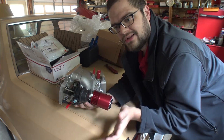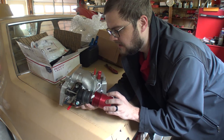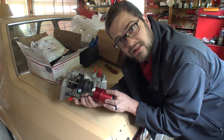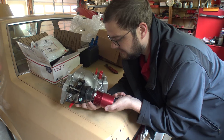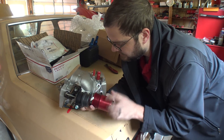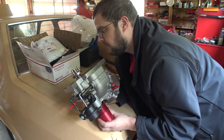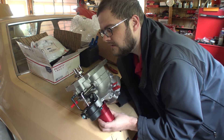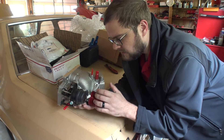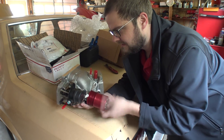There is a lot of controversy about how these slip and don't work, but I think I have an optimal setup for it to work. I'm not spinning the hell out of it - no lower pulley modifications, just the upper. This pulley is very small and it's hard to get traction when trying to drive the blower hard, but I'm not really trying to drive it that hard. Nobody is even dumb enough to put these on a 4.8 like I am, so we will learn. He even put allen keys in there for me - that's nice. I have a manual tensioner setup and I'm going to have like 99% belt wrap on this thing.